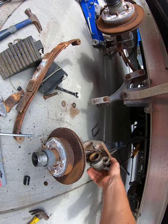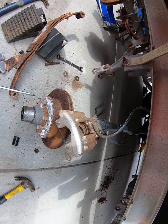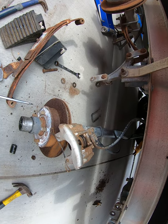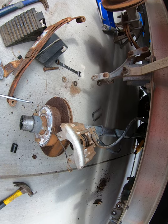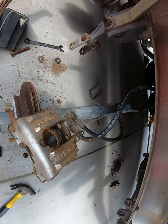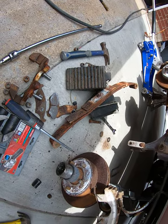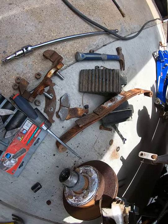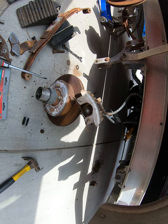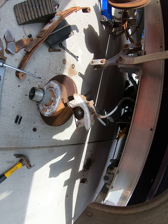These are your UFP brakes — the DB35 model. I found them on a trailer website, so if you need to know which model you have, these are the DB35s. I'm going to get the new dust boots, new clips, new retainers, new caliper guides, and new brake pads. I found them at Redneck Trailers — the DB35 kit was about $39 each.